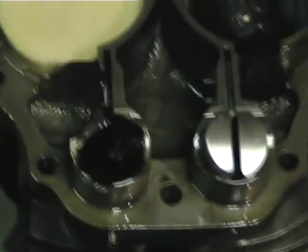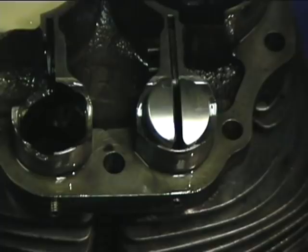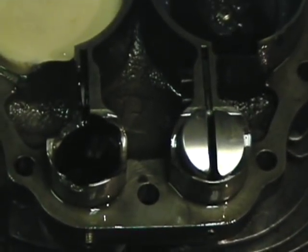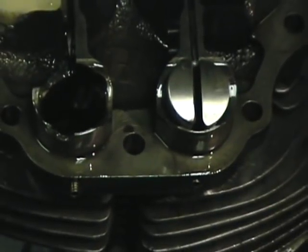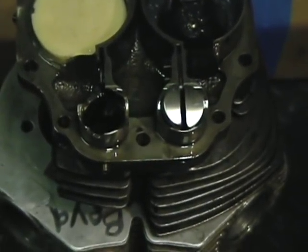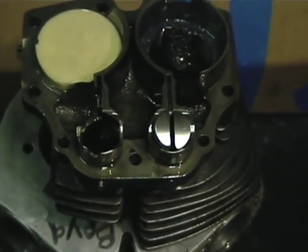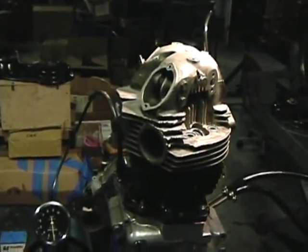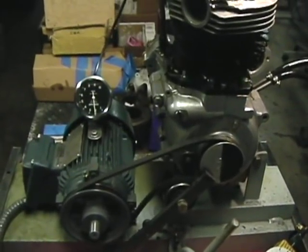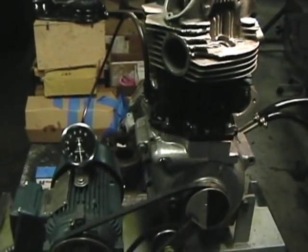I think I'm going to put it back together and run it up to redline — basically 6,500 RPM — and run it for something like an hour, and then probably back it off to idle speed for a while and make sure everything still looks good. Button back up. Valve clearances have been checked; they grew by maybe a half a thousandth over today's running.